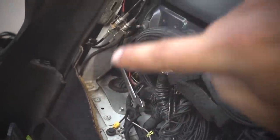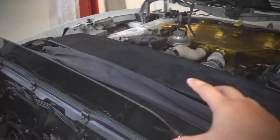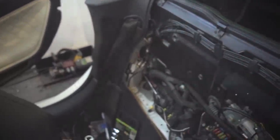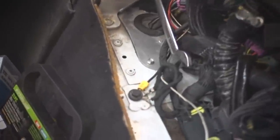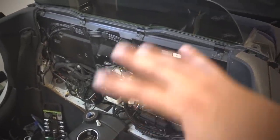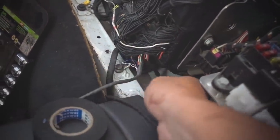So I did a lot of rewiring as well. I actually had to lengthen some of the harness so I can run it underneath this pillar, because the way it was ran I had the throttle body harness — it's actually a separate harness from the engine — and the throttle body harness goes above the seat belt and every time I move the seat belt it would rub on the harness. So I had to go into the pillar, lengthen the harness about 10 inches, and then connect it to my S12 ECU. I also have the ground situation right here and made sure that all the grounds are very clean there and there and also right here.